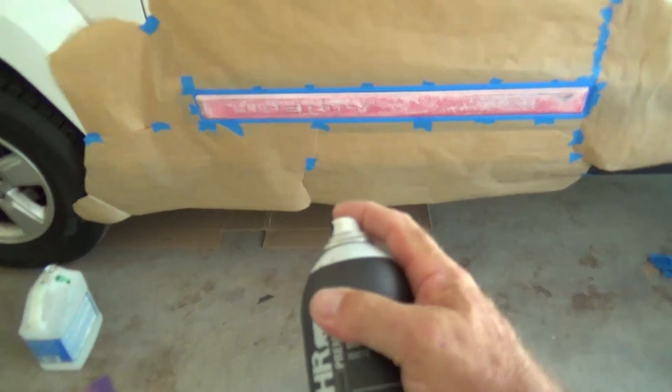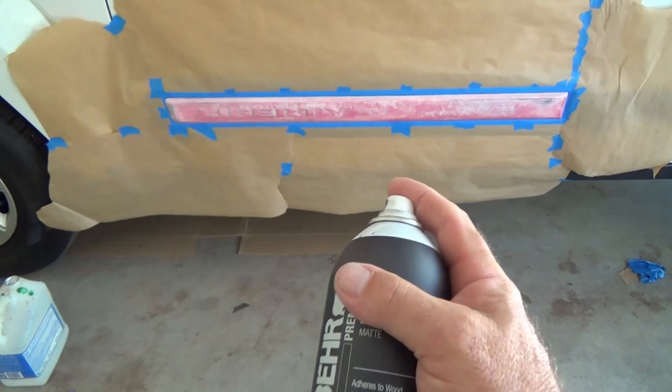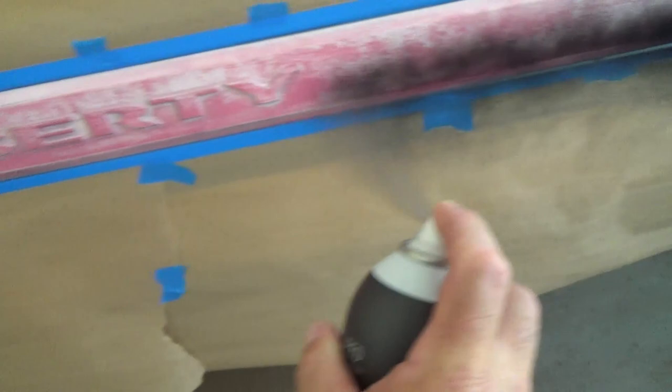She's taped off pretty good. Make sure you give your can a good shake — don't be timid with the nozzle. If you just lightly push down you're going to throw out spurts of paint; you don't want that. You want a nice fine fan of paint coming out. I like to do the edges and hard-to-get places first, then come back over the front with just a light touch. It also gives you time to get the feel for it.